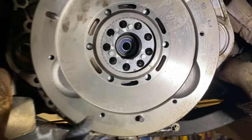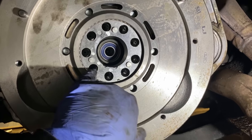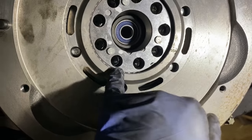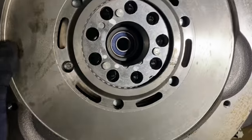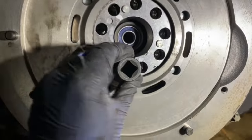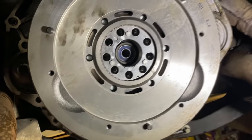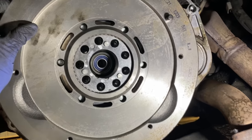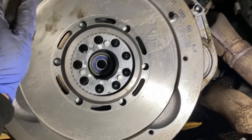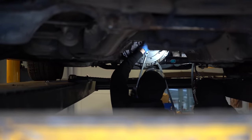The flywheel is in. I really don't understand why specifically these flywheels have a T60 inside, but the outer hole doesn't match the bolt — it's not 100% aligned. I had to grind the T60 bit slightly so I could get it in, and even then it's slightly off. Unless all M62 manual flywheels have that issue — maybe BMW has a special tool for that. Let me know.